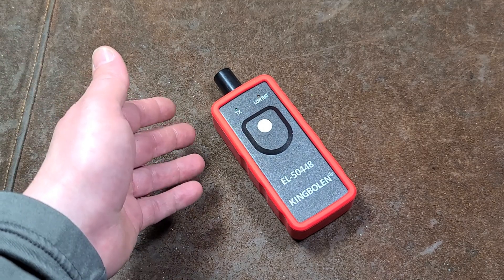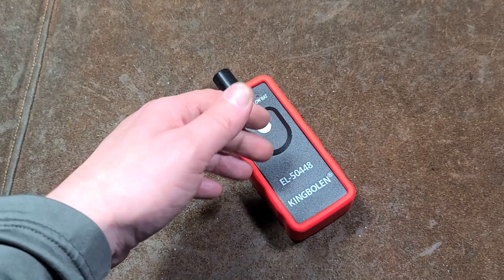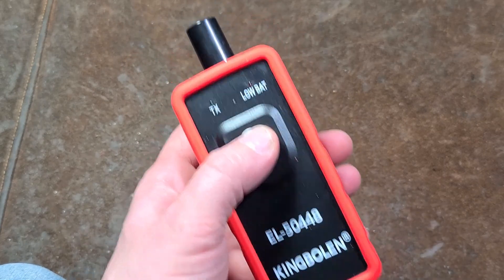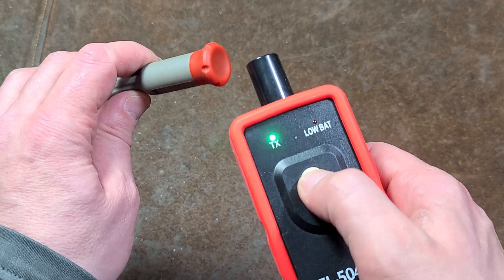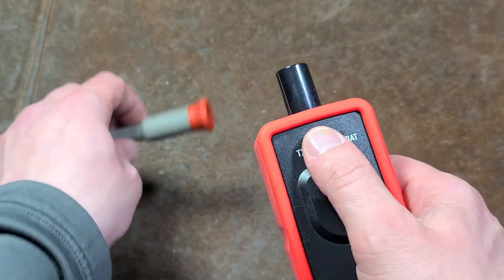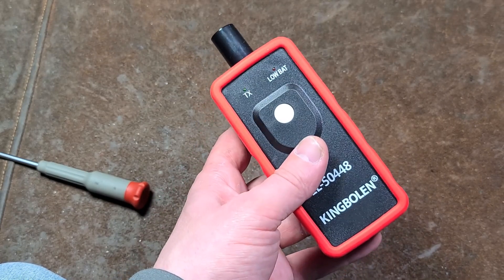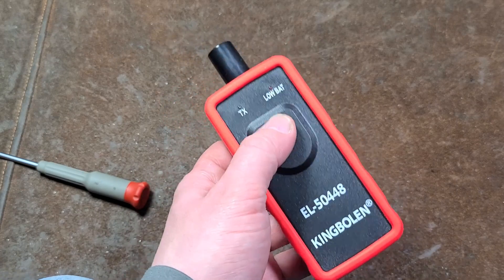It's apparently just a simple procedure, such as pressing and holding the trip button, or going through the car menu and selecting reset tire pressure or tire pressure monitoring calibration. Then this is just a tool that you would stick near each of the valve stems. You press the button, it does a little flashing thing with a pretty bright LED, and it's just sending out a signal to cause the sensor to transmit a code or transmit that it's there. Then the car will beep and it will be synchronized.